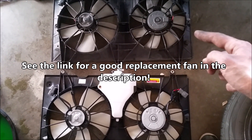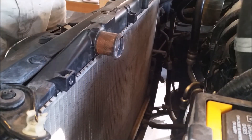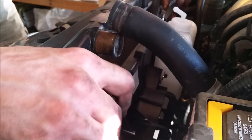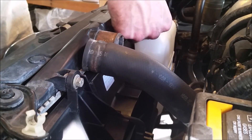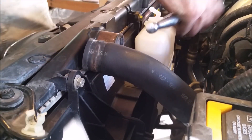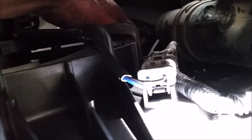Here's the new one versus the old one. There's one little clip you need to take off the old unit and install on the new one. Drop the new one in place and line up the three little pegs on the bottom. So you've got three bolts on top and three little pegs on the bottom to hold it in place. Re-insert these and line everything up — the holes line up great, it's a good part.